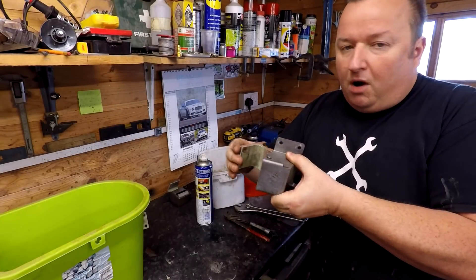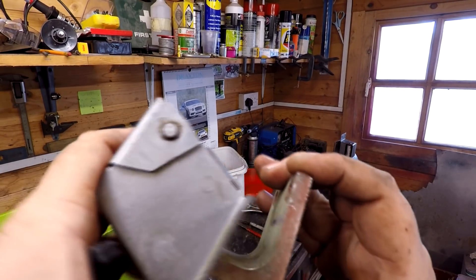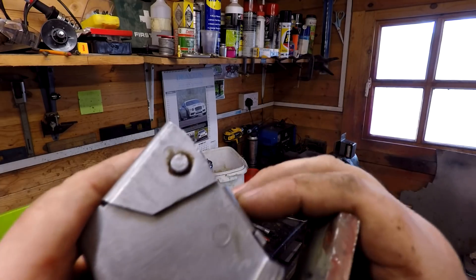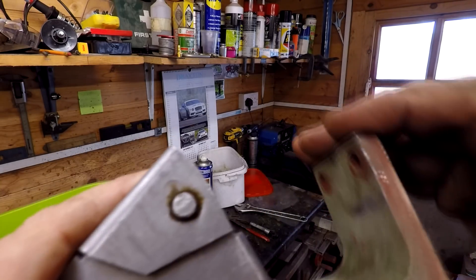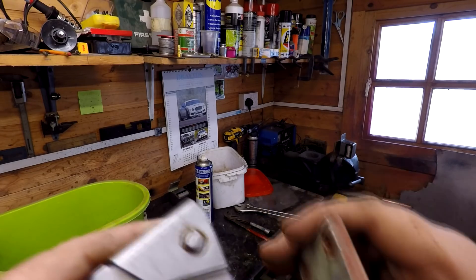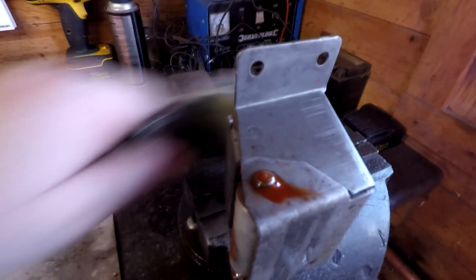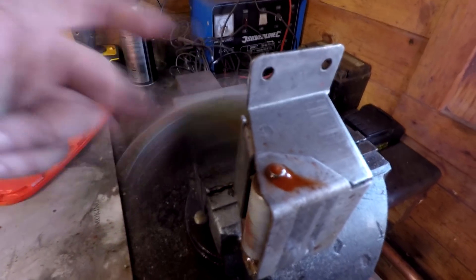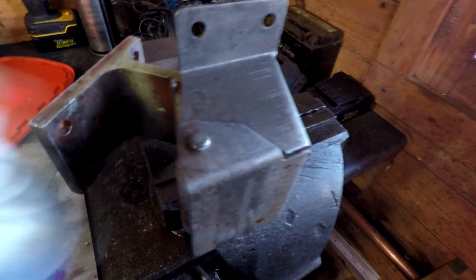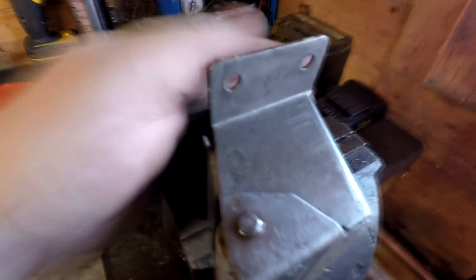What I've found out is you can probably see this pin on this side here — this is where it actually gets stuck up, not in the actual main pin shaft along there, but around there. The centre shaft is now rotating — well, that was very, very tight. As you go backwards and forwards, you could keep squirting WD-40 in there and they will come free like this. You can see exactly what I mean by this one — look how free this one is now. You can flick that one with your finger. All I've done is just gone backwards and forwards on that pin. Just redouse it with WD-40 or some other spray and just go backwards and forwards. This is the sort of thing you do when your pliers seize up as well — it frees your pliers up. And you can see the rust lifting out of that joint there.